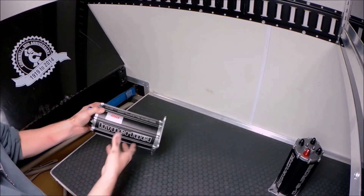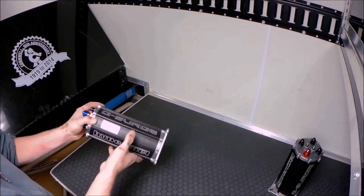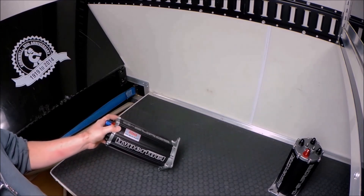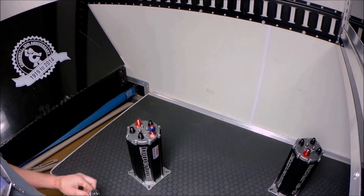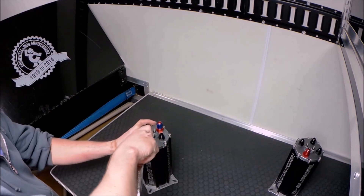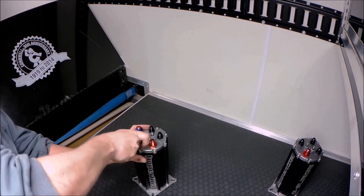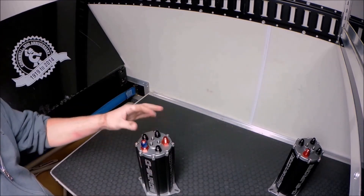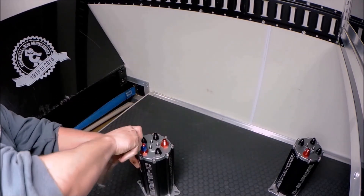What we have here is the Phytek double pump — the HyperFuel G-Surge. Phytek is the main parent company and HyperFuel is the product line. This is the dual pump setup; it has two 340 liter per hour pumps inside. We're going to open it up and show its guts. You can tell it's a double pump setup by the two red fittings on the top — that's a dead giveaway of a double pump assembly.